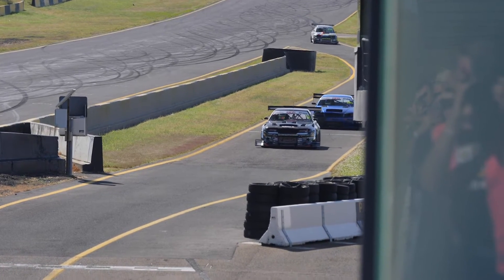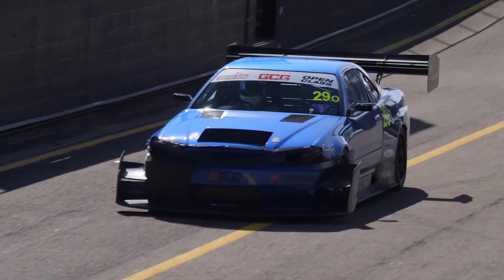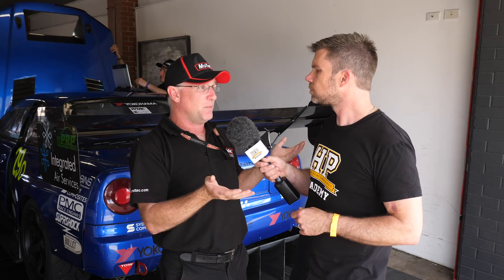So that's helpful in some situations but not others. One of the classic things they want to do is once they get up to high speed down the main straight, they actually want to unlock the centre diff — so you're not wasting all your power driving the front. Because you're already going fast and accelerating hard, you don't need as much grip to move the car forward like you do out of a corner. They'll unlock it down the straight, and as soon as you get on the brakes into a corner you've got to lock it back up again. But a tight corner versus a long flowing corner — you might want something different. This is where the whole lap distance concept comes in.